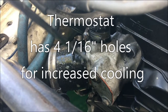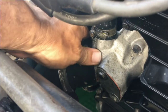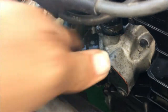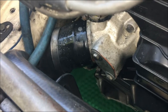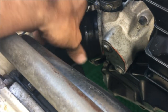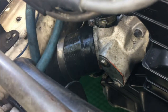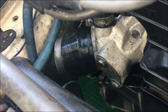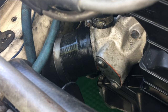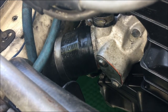spray a little bit of soap with water or some degreaser here. And then what you can do is start working it back and forth with a screwdriver. I can't show you with the camera, but you get the idea. Get that soapy water in there and gently make sure it's loose all around, and then add more soap as you're doing it, and so this will come off nice and easy without damaging the hose. Because unless you feel like replacing every hose you touch, you better learn how to get them on and off without breaking them and damaging them. Even if you are going to buy a new one down the road, it's better to try to keep them intact, just because that hose might be harder to find in the future.